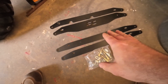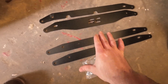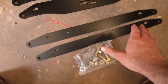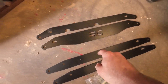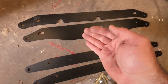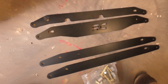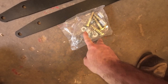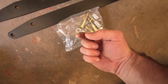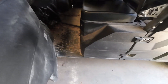Here is the stuff that comes in the box. You have the rear brackets and the front brackets. How you know the difference is the front brackets are identical to each other — you could put them on top of each other and all the holes would match up. The two back brackets are the different ones. The one with the RC logo goes closer towards your tailgate. You also have bolts, nuts, flat washers that go on each side, and spacer bushings that go in between the strut supports.